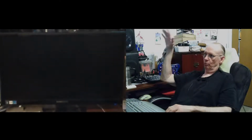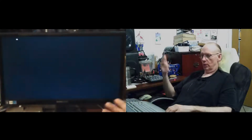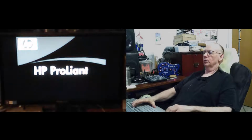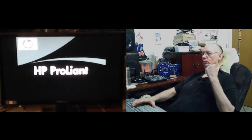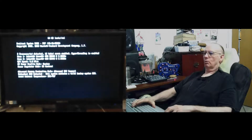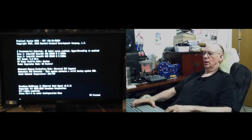So that taught me something though. I can't even hook up a second one of these IP security cameras on my Wi-Fi on this same router. I've got another router, and there's two ways I could do it. I can set one router to be a Wi-Fi repeater to have more strength from one end of the house to the other. But I think what I'm going to need to do is put them on another subnet, and just leave that other router as it is. Okay, HP ProLiant. Put it on another router with separate IP addresses, and that will probably be the best thing. Except in the living room, that other one is the dominant one, so everybody in the living room would have to change the router they're on. That would be a pain.